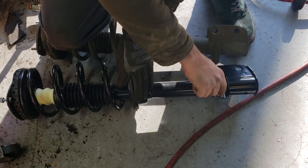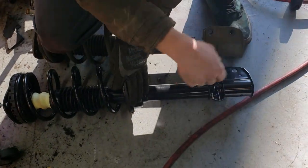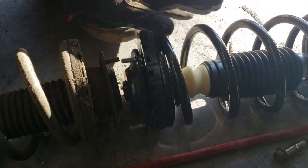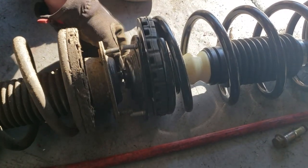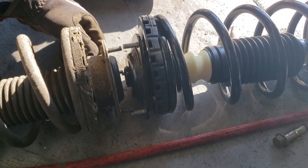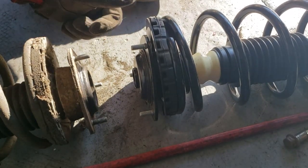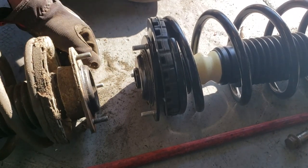I'm going to try and cut this section out so we can still use the brake line clip, since these don't have the bolt-in style for the brake line. The newer Forester struts have a bolt pattern on the top hat that's just a little bit bigger, so we're basically going to oval out each of the bolt holes just enough to accept those studs. We'll do some measuring, mark it with Sharpie, oval out each bolt hole toward the outside just enough to fit them in, then put nuts on with washers. It's pretty common.